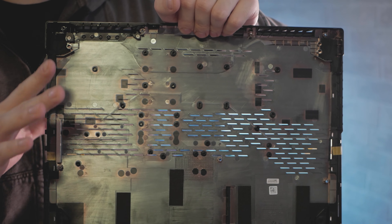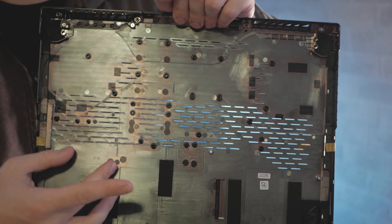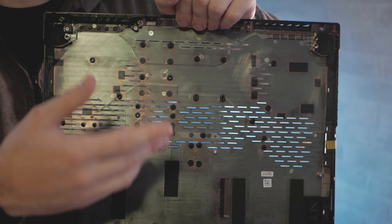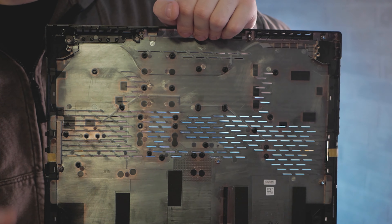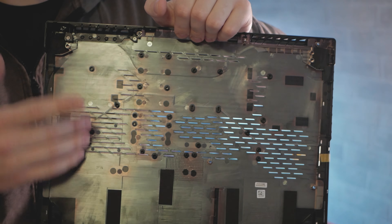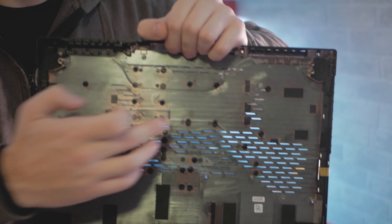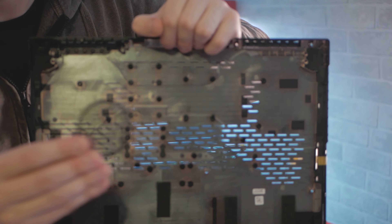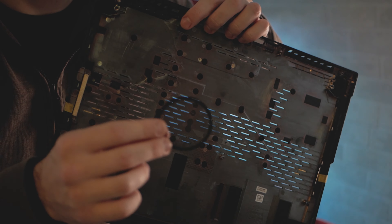Part of the fault is also from Asus in my opinion, because they didn't do a great job with the cooling solution. The fans are up here — fan one and fan two — but the intake holes are all the way down here, so the fans don't have direct access to air. The processor is running at half speed all the time due to thermal throttling. The GPU is fine because it has exhaust on one side and at the back, but the CPU only has this little hole right here, and it's the hottest thing in this laptop.